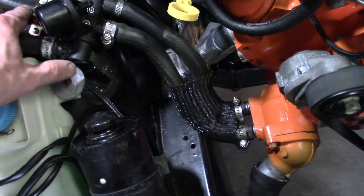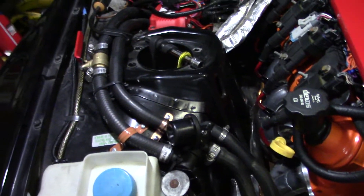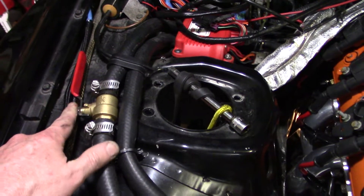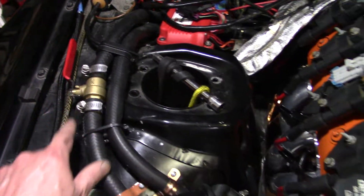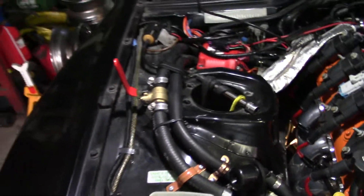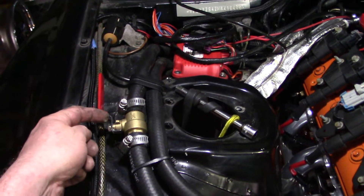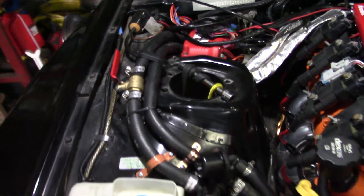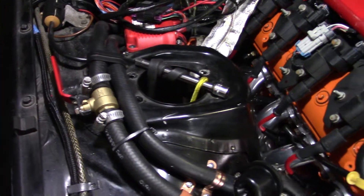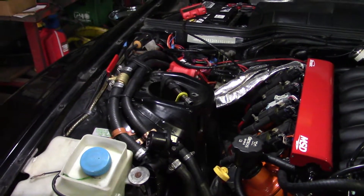Then we should have the cooling system done. I did pull this hose and shorten it, so these hoses look pretty good now, and I put a couple of brackets on here to hold them to the fender. We're still going to have to shorten our master heat shutoff valve because when it's like that you can't shut the hood, so we may just take it off, cut it down, or cut it short and bend it around so you can grab it and twist it.